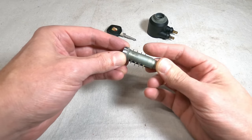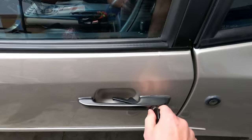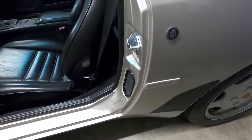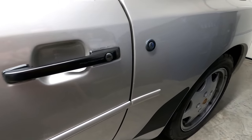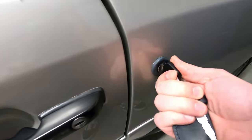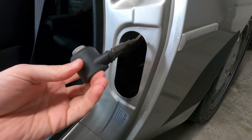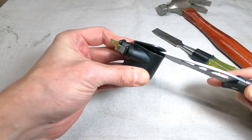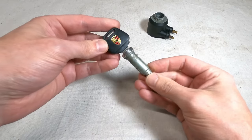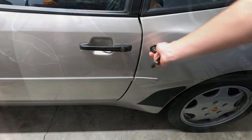The last mechanical modification on the list involved rekeying of the factory alarm switch to match the ignition key. Prior to 1989, any 944 with a factory alarm system featured a keyed alarm switch located on the rear quarter panel that was separate from the door lock switch, which meant there was an additional set of keys required for activation — so this can be a useful mod if your alarm key is lost. With the switch assembly removed, the lock cylinder can be accessed by carefully cutting the back cover from the plastic housing so the pin tabs inside the cylinder can be removed or reoriented, using the ignition key as a guide to determine which tabs require adjustment. Once the necessary changes have been made, you'll have the convenience of the alarm switch accepting the ignition key for operation.